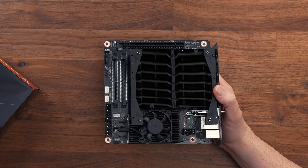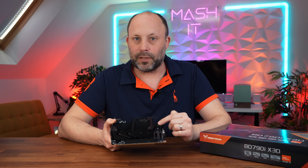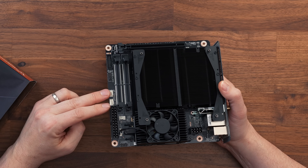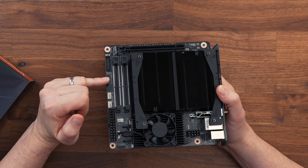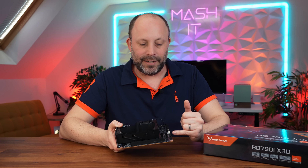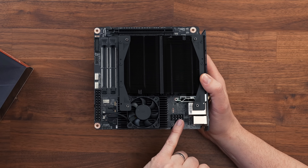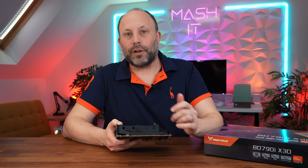Another thing on this motherboard is we've actually got laptop RAM — you can see the two small SO-DIMM slots. Now this can take up to 5200MHz RAM sticks, and I'm going to try and put my 128GB RAM kit in this board. We've also got the CPU fan header for this large fan, plus two extra fan headers for your system fans. We've got an audio adapter for your front audio port, the header adapter for all your front panel connectors, and a USB 3 adapter. Sadly there is no front USB-C header on this board, but with these two Gen5 slots already on here I think most people will be covered for storage. We've got the normal 8-pin and 24-pin power connectors for your PSU, and at the bottom you can see a PCIe 5 X16 slot for your graphics card.